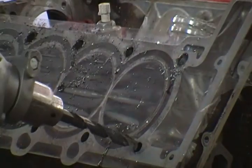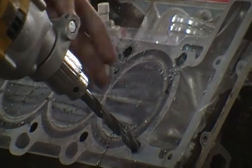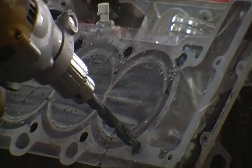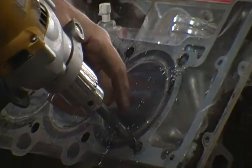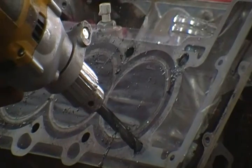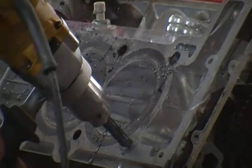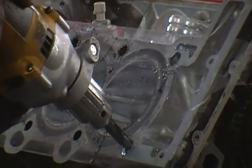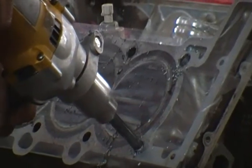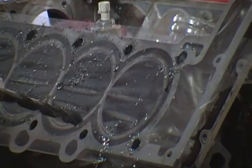If you get a close-up of this, you can see there's a little bit of depth right there — the very beginning of the bit just kind of falls in place because it's a half-inch bit. When we spin it a little bit you can see how fast it goes down. It jerks a little because it's tight, but it goes down fast. At this point it's actually touching the top of the threads. Get a good handle on it, hold on tight, and give it some strength. You see those chips coming out? That's some good consistency. Hear that solid contact — let those chips come out so I can move on to the next one.